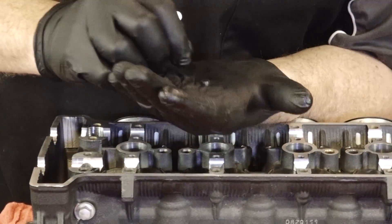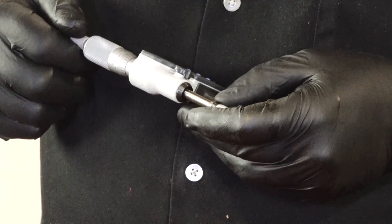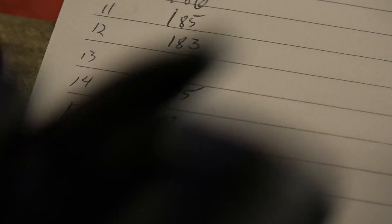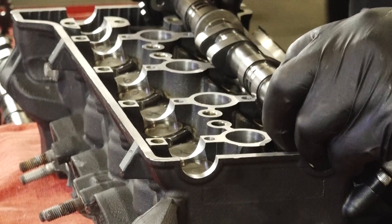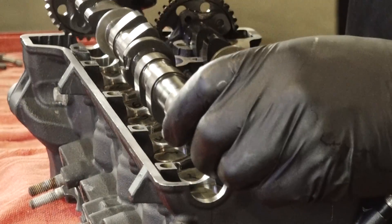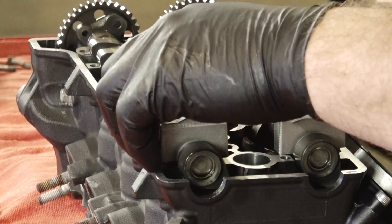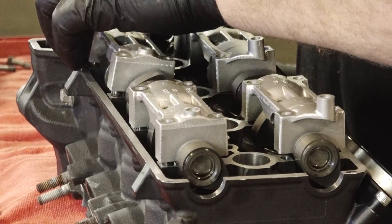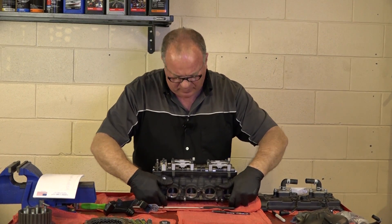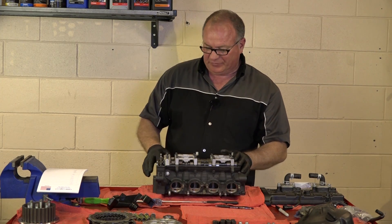One thing I need to note is that most of the time you'll be able to see the number on the shim. In the case of the second one that I pulled off, the number has been worn off, so we need to do a quick measurement on it. Next, let's go ahead and get our cams in. When you're doing this, you want to bring them down evenly because these cams are very brittle — the last thing I want to do is snap one of them. Also, notice I have the head kind of spaced up here, because as we tighten this down, some of the valves are going to open and we wouldn't want it to go into the table and potentially bend a valve. That would be a bad thing.